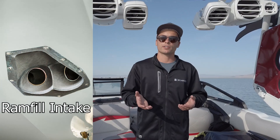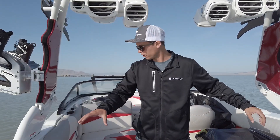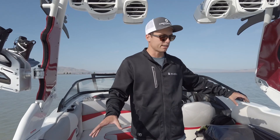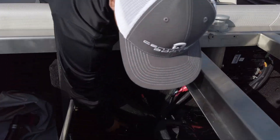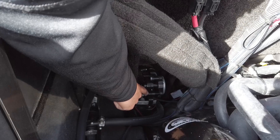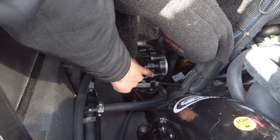The way it works is there are two valves on the bottom of the boat that fill while you're moving. Water floods into the ramfill tanks and fills up 1,500 pounds on each side of the boat. When those valves open and close, it does so mechanically through these ramfill fill valves down here — this is the black actuator, and when you hit fill, this is actually what moves